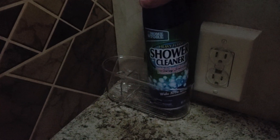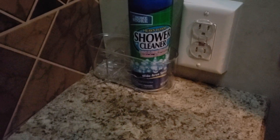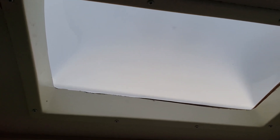Here's a tip for your toilet: spray foam on it before you use it and it'll be much easier to keep clean. While we're in the bathroom — some motorhomes have a skylight, but if the outer top part gets cracked or broken due to UV rays, the inside one may look fine. However, the broken outer one will let water drain through and hit the inner one, then go into the motorhome. Check those from the top. Also, this motorhome had a glass shower — it kept hitting my elbows and was always rattling, so I replaced it with curtains and like it much better.